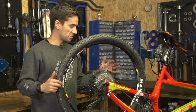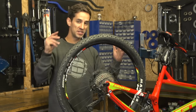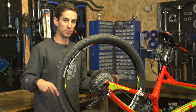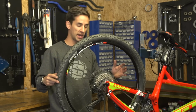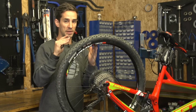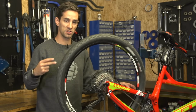With a used wheel, you can get out a lot of the side movements as long as they're not too big. But if there's any up and down movement, so if your wheel is a bit egg-shaped, it's much more difficult to get those out. When you're building a wheel from new, you think about pulling the rim from one side to the other to straighten it out. But once your bike's used, your rim might have been smashed a bit, it's almost impossible to get those egg shapes out. I'm worrying more about the side-to-side movement.